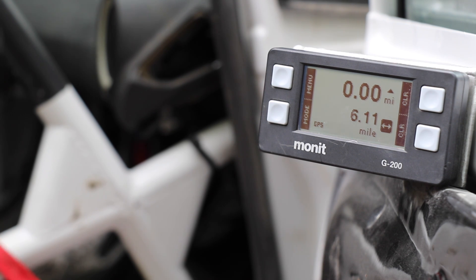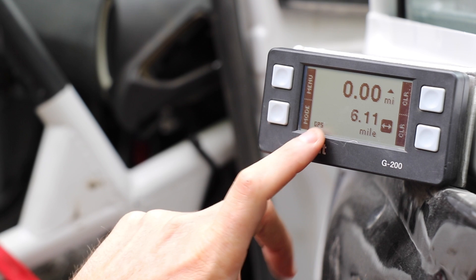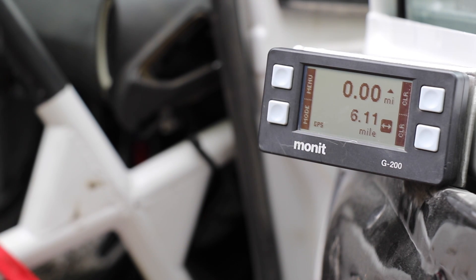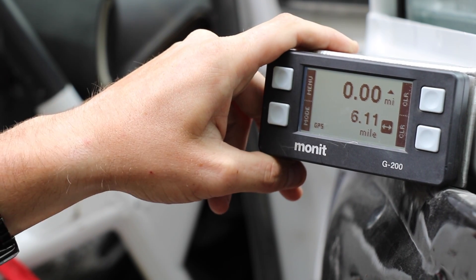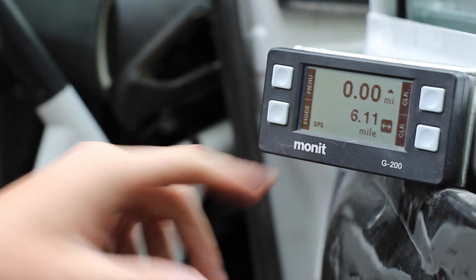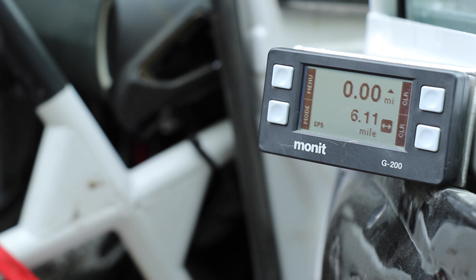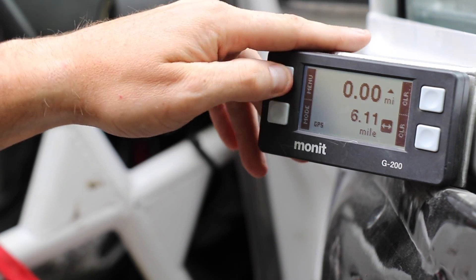If for some reason your odometer isn't that accurate — in this car, this runs off a GPS, which is very, very accurate. So in the old days, you had to worry about your odometer being off when you spin the tires or lock up the tires. You might do a rally in the snow and find that five miles into it your odometer reads seven miles because you spin the tires like crazy. The GPS setting is really nice and helps for all of that — it's a much more accurate mileage than using a wheel speed sensor. This does have that as a backup and you can switch to it, but you don't use that primarily.